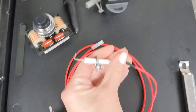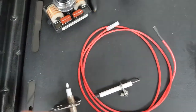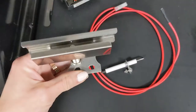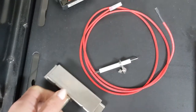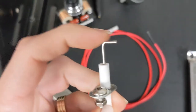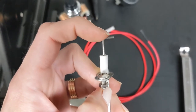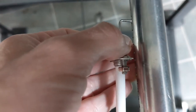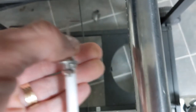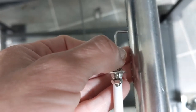Your electrode is connected to your burner. This has a little mounting bracket here. You might also have one that looks more like this, mounted more into the grill. This little piece right here is the probe of the electrode, and this is the piece that actually needs to be close enough to metal to spark. If it is not very close to metal, when the spark comes out it will not jump from one piece of metal to the next. We've had customers whose electrode probe was simply not close enough to their burner, and that's why their electronic ignition was not working.